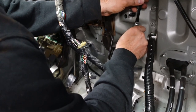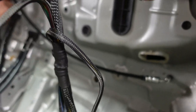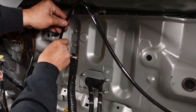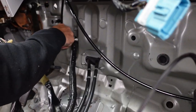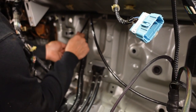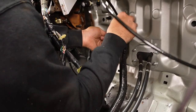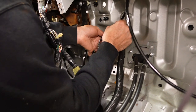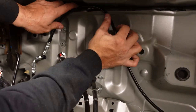We've got our driver's side brake line connected to the T. This is our passenger side. This line, you can actually just angle any way that you want. Nice and clean. Sorry about the focus. There it is, much better. So coming out of the firewall on top of there, we can definitely strap it to the firewall too, Trap. Are the bulkheads both tight? Did we tighten them? No, this bottom one isn't tight because I didn't know where I was going yet. I could still tighten it from the other side. I want to be kind of up and out of the way because we're never really going to touch the brake lines after this.